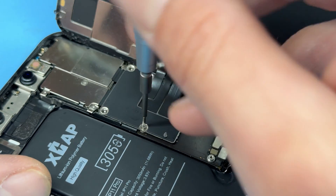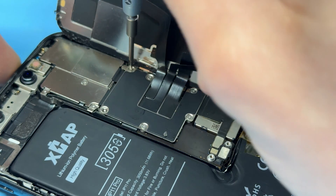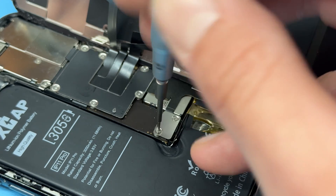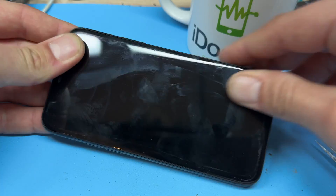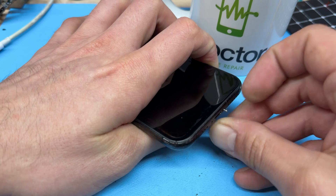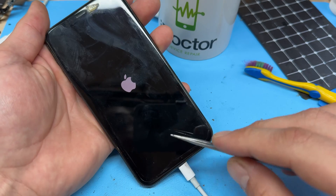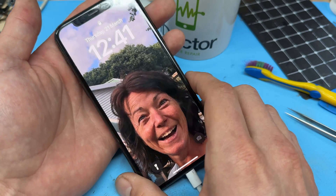If you've had a go at this repair yourself, let me know how you get on in the comments below — we do enjoy reading them, especially the ones that blame us for all their errors. With those secured, re-secure the battery shield down with two tri-wing screws, then fold down the screen and re-secure it at the top, squeeze it into place on the edges, and finally reinstall the two pentalobe screws at the bottom. Remember there are a few things to test once it's turned on: the loudspeaker, vibration, and obviously the charging function — just make sure everything's working. Thank you for watching and see you next time.